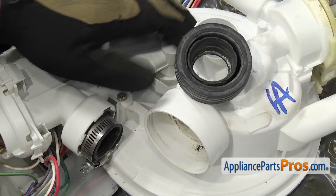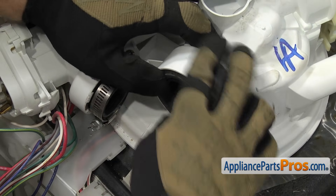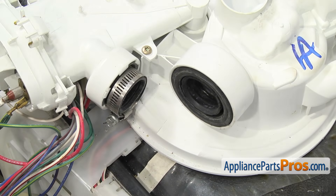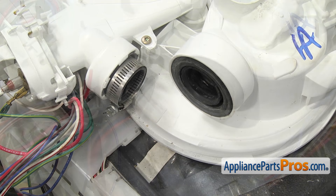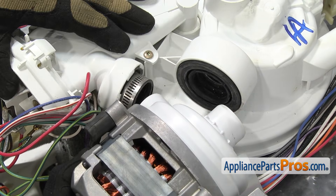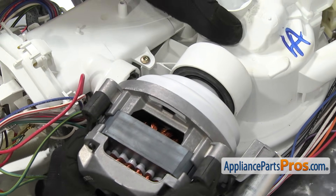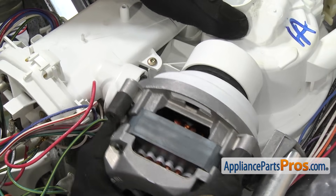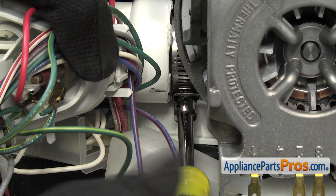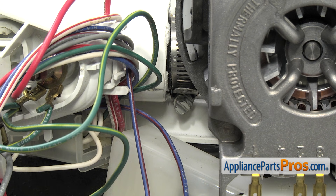Once you have them both swapped over to the new circulation pump, we can put it into the dishwasher. Now that we have everything cleaned up and before we put the new part in, we're going to put this seal back in. All you have to do is press it into the housing — make sure you get it all the way down so it bottoms out. Once you have the seal back in place, we can put the circulation pump in. Make sure your clamp is still there, then put this fitting in first and slide it over and push the circulation pump all the way up into the sump assembly. Once you have it in place, we can use our 5/16 inch nut driver to tighten down the clamp that holds the fitting.